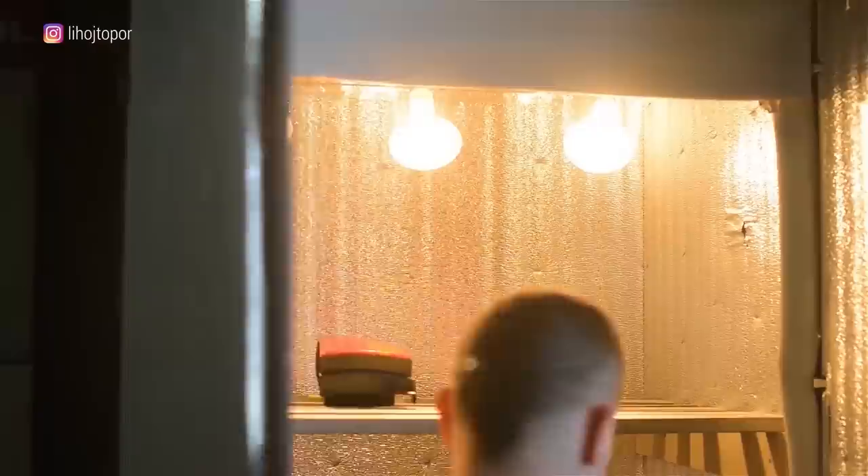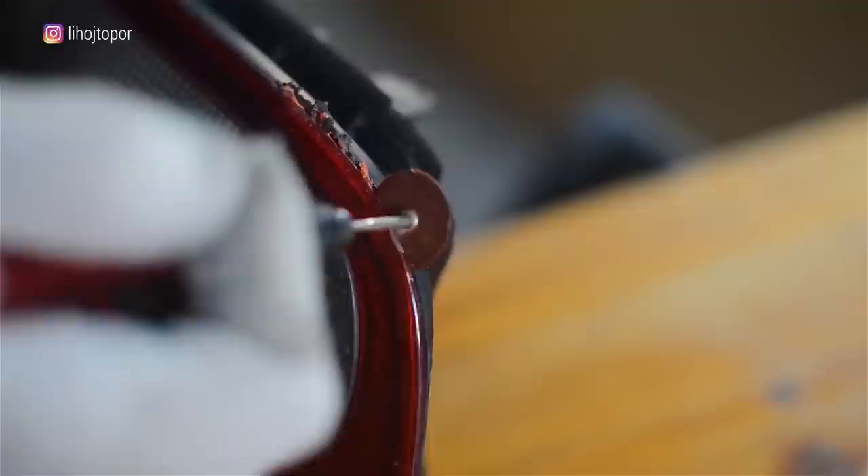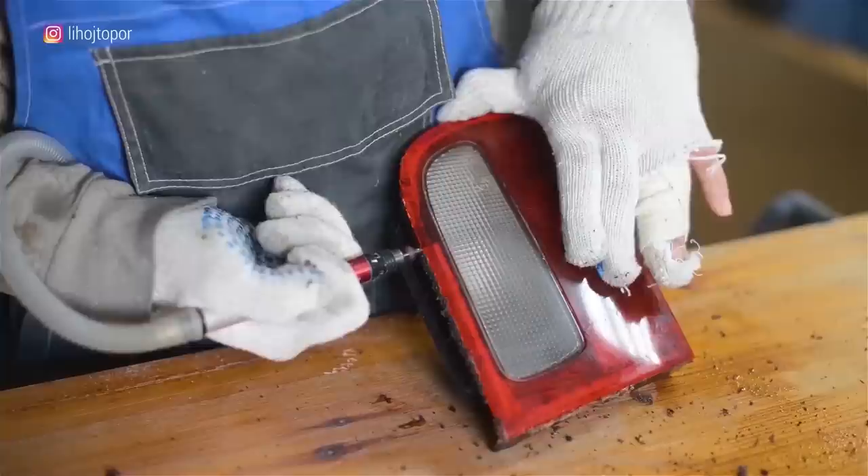The oven has three infrared lamps, which are often used to keep chickens warm. We leave them for 30 minutes and wait until the sealant warms up to 70-80 degrees. Unlike the main part warming in the oven, the second small part — Japanese engineers for some reason decided to glue tightly. So in this situation we take a small disc grinder and split the taillights.